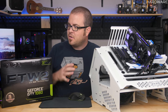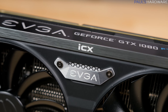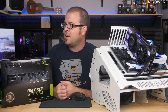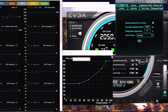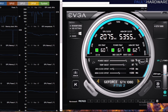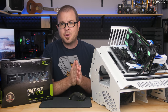Speaking more realistically and critically, they're not using new GPUs — still GTX 1080, 1070, or 1060 depending on the card, so we're not looking at a vast or even significant difference in actual performance. I did attempt some overclocking and found it overclocked about the same as most other GTX 1080s I've tried. I was able to hit 2050 MHz pretty stable at stock. Cranking the fans up to about 2000 RPMs added some noise but brought temperatures down by about 10 degrees — from hovering around low 70s down to low 60s — allowing about 25 MHz more on the overclock, so about 2075. But you're not looking at a night-and-day difference; don't expect two, four hundred MHz more unless you're doing crazy cooling or going wild with voltage.